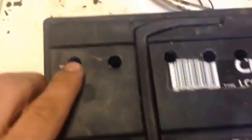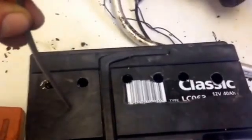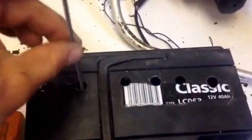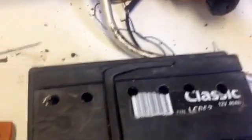All you're doing is topping it up to above the plates — it's really difficult to see. Don't do this with anything except plastic, otherwise you can end up with it touching the plates. But you can actually see with this one, there's absolutely nothing in there at all. It will take a surprising amount of water, actually — they always do.